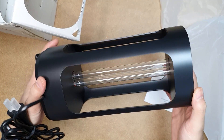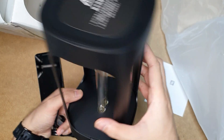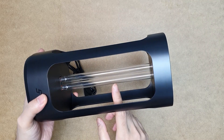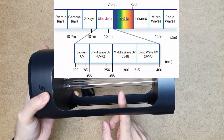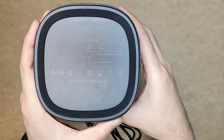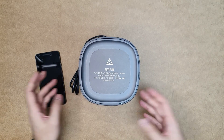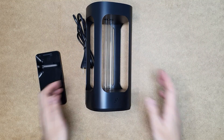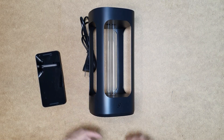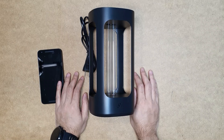This is the device — it looks very nice, and these flexible parts are present to prevent any damage to the lamp. The lamp here is made by Philips; they claim to have 9,000 hours of life and it operates at a 254-nanometer UV spectrum, which is the UVC spectrum. It is RoHS rated and has a 32-watt UV lamp, which is quite large compared to other devices available online. I also want to warn that many UV sterilizers available online are fake — you should be very careful and buy only from reputable brands, because there are many blue or violet LEDs being sold as UV sterilization lamps, but those are actually fake.